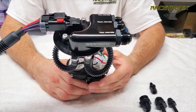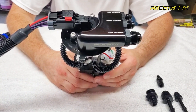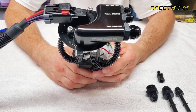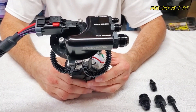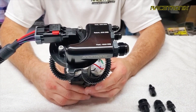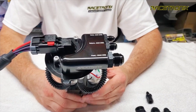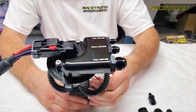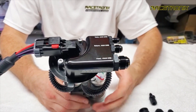For maximum performance, we'd want to see a dash 10 PTFE feed line and a minimum dash 6 return line. The pumps are staged so that the secondary pump can be turned on either with a pressure switch controlled by our wiring harness, or if you have an aftermarket PCM that has a secondary output control for a pump, you could use that as well.